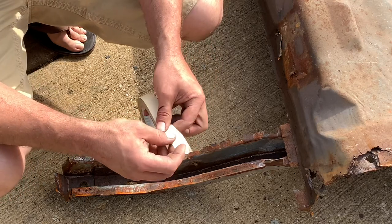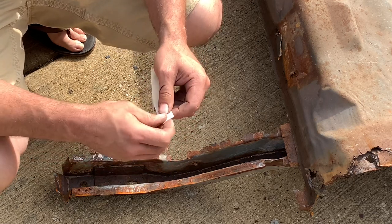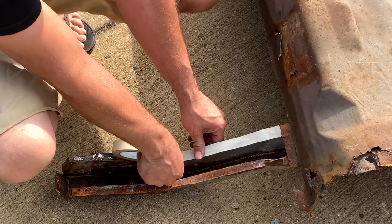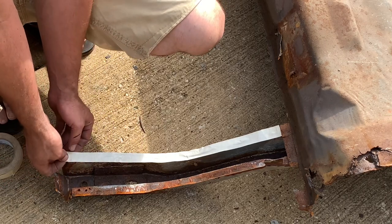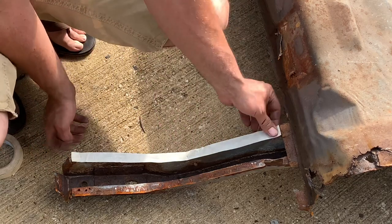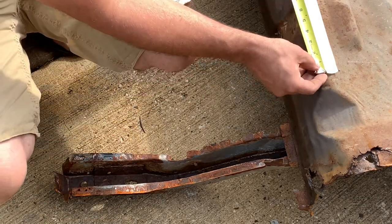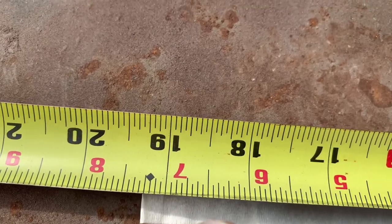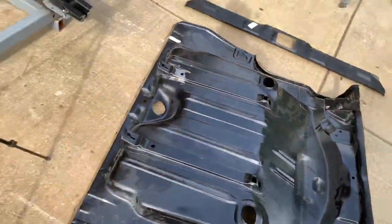Here's how we're going to use this as a tape measure. Sometimes these metal ones — you try to get them on a radius, keep it tight, hold it in place — they just don't stay very level to the fit. So what we're going to do: make a nice clean end on the start here by folding it over, hopefully back onto itself like so. It gives you a nice clean straight edge — a nice solid reference point. Literally just kind of drag it along. This will stick to the radius — it's more flexible. Do the same with this end, find where it needs to be folded over. Once we're happy with it, peel this bad boy off, lay it on a flat surface. And as you can see: start at that end, nice and square, come down to here — 19 and a quarter, on the money. So if you want to know where to start: leading edge of those frame rails to the leading edge of the trunk floor is 19 and a quarter inches.